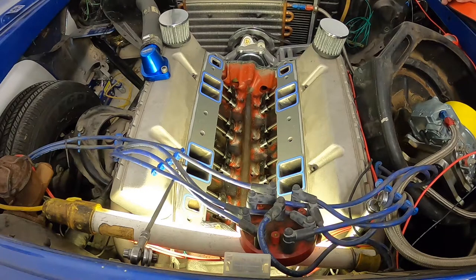But that's not a stock block, right? No. You would start with, of course, the aftermarket makes a lot of blocks, but the GM Marine engine is a much meatier block. But even then, the weak part is crankshafts. And it's not necessarily that the crankshaft is weak in a small block engine like this one. It's the webbing. The webbing moves in it.